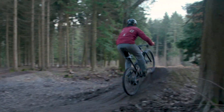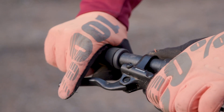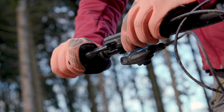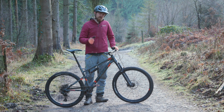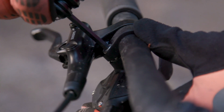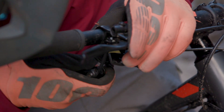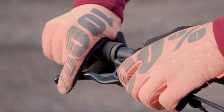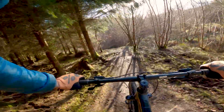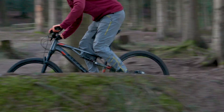Once you're happy with your bar roll, move on to step five: setting up your controls. The first thing to set up is the brake levers. With your hand resting comfortably on the grip you want your index finger to sit naturally just inside the curved bit at the end of the lever blade — this gives you maximum leverage on the brake for maximum power with one finger braking. You may first need to loosen the shifter so it can slide out of the way, then loosen the clamp securing the brake lever to the handlebar and slide the brake lever inboard or outboard to that position, then retighten and repeat on the other side. Most modern bikes will have plenty of power to stop you with one finger braking, particularly if you set them up to maximize the leverage of that one finger.